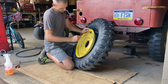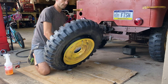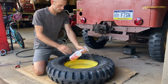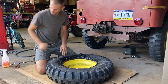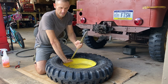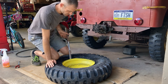Give it a little wiggle and put it through the hole. You can see I'm still pulling down so it can't fall out. Flop your wheel down. Spray your soapy water on the back bead. Push the wheel all the way to one side. It's important you do not want to pinch your tube, so every time I put the tool in there I put my hand in with it and make sure the lip of my tire iron is not on the tube. By not putting air in the tube it's a lot smaller and a lot less likely to get pinched. Just fold it over.